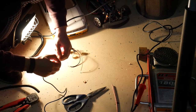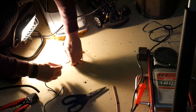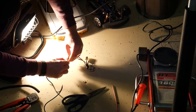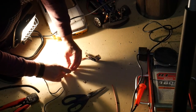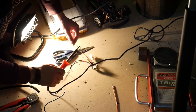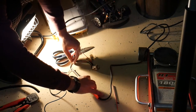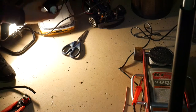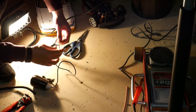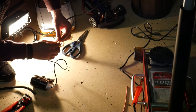Prepare your wires. So, we'll go black on black. Just twist and go. We'll do that one first. Grab your soldering iron. Just repeat as we did before. So once you're relatively happy with your soldering, just grab your heat shrink and just slip it over the soldered area, just make sure it doesn't catch on any wires.